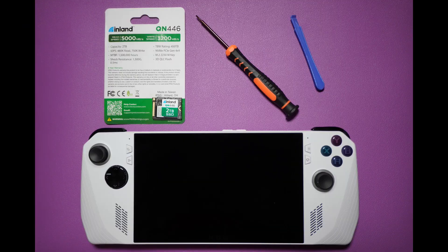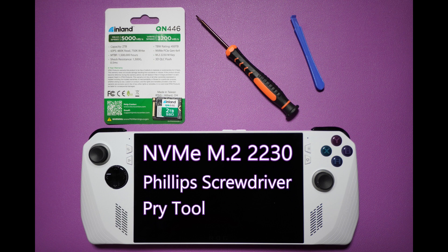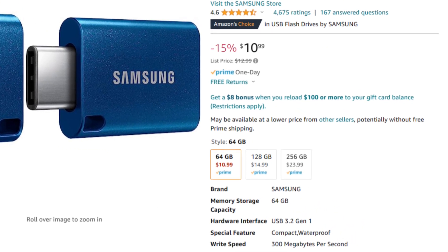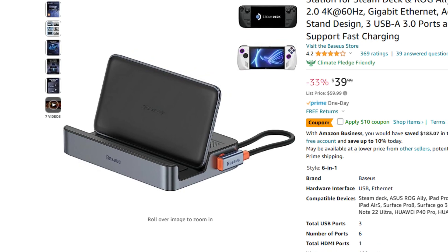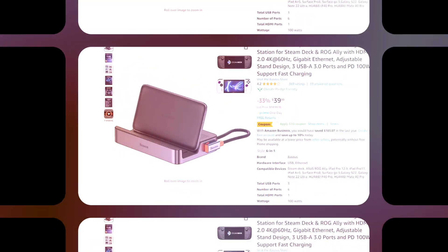Before we start, let's make sure we have the right tools for the job. You're going to need an NVMe drive — for this video I'm using a 2TB drive that I picked up on sale for about $160. You're also going to need a small Phillips screwdriver, and I highly recommend having some kind of pry tool. Also, if you're going to use the USB setup route, you'll want to pick up a USB-C thumb drive and maybe a hub that has the ability to connect directly to your home network, just in case you aren't able to use the cloud recovery option. You don't need the hub, but it makes manual installs a lot smoother. I'll add a link to everything I used down below in the description.